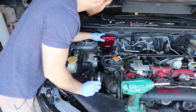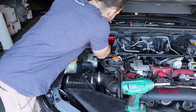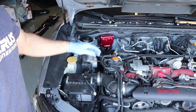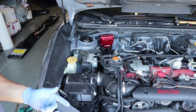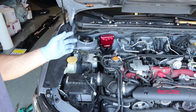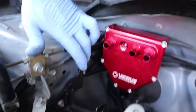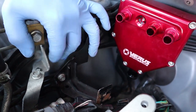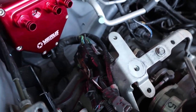The M6 is 12mm long, the M8 is 8mm long — it's a 4mm allen for the M6 and a 5mm allen for the M8. We've got the bracket installed, the AOS is on the car, and the factory bracket is installed as well so we can install the wiring harness. Now we're going to remove the factory PCV from the transfer tube and install it on the AOS, which is already on the car, and then start running lines.